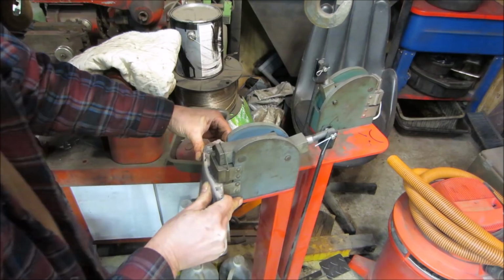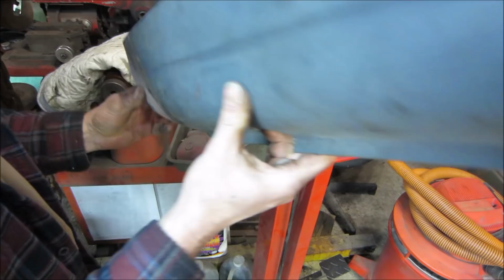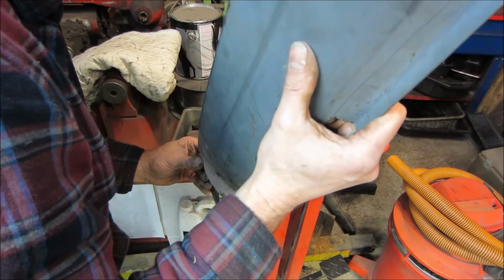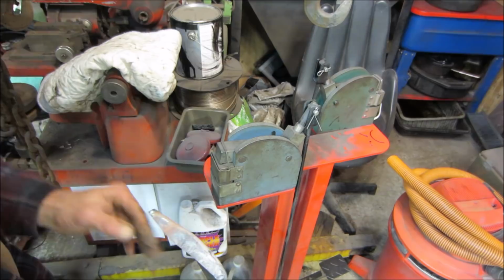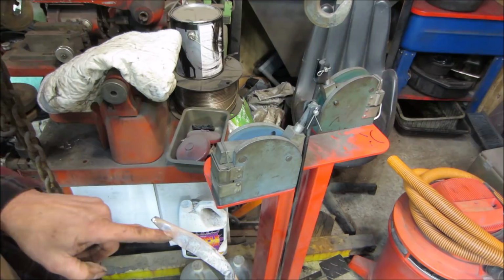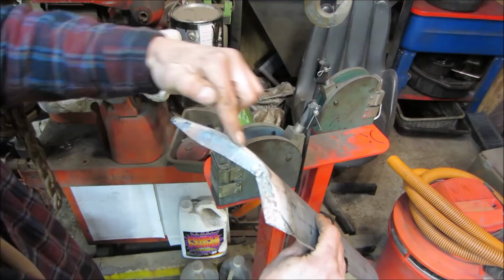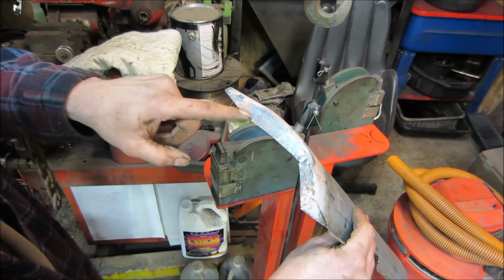I need it right there. That's better. See, it's got the curve to it now. Gradual curve. We'll trim this back once we figure out what the lip is. But we're just trying to make this body line and this roll. Could you see that? This body line and this curve in the right location. And then we'll slice back after we're done, you know, the correct reveal afterwards.